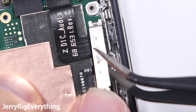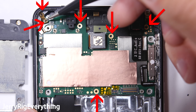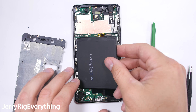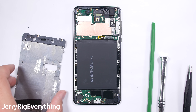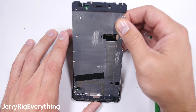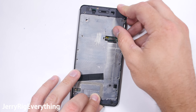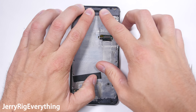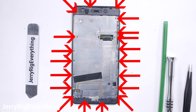Following this extension ribbon down to the charging port, we find 4 more screws. Remove those and unclip the wire cable — the one we destroyed the other end of — and the micro USB charging port can pull away from the frame. It's tucked underneath those little metal tabs on the frame, just like the motherboard up top. It also has a little microphone down there at the bottom next to the micro USB port. The loudspeaker has its own special section in the frame of the phone.